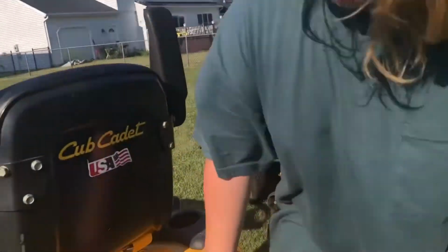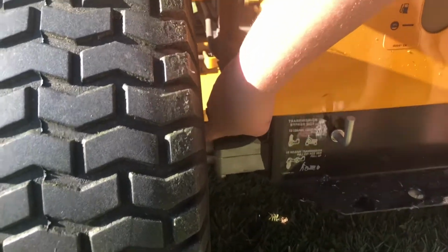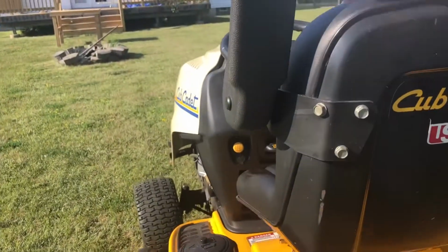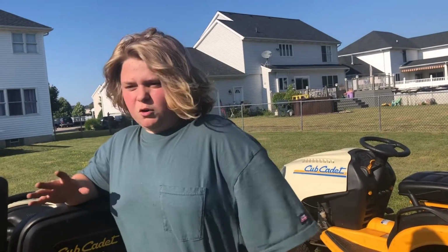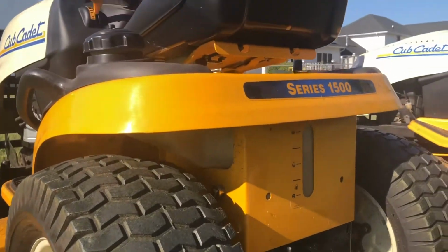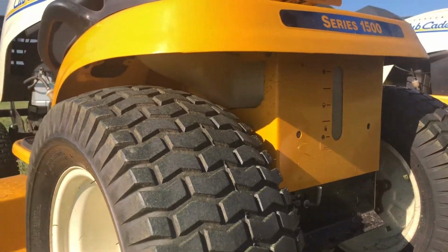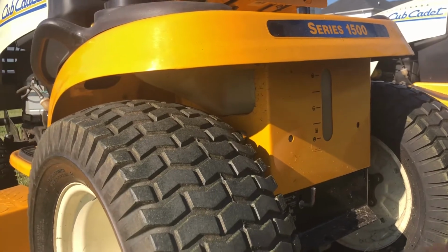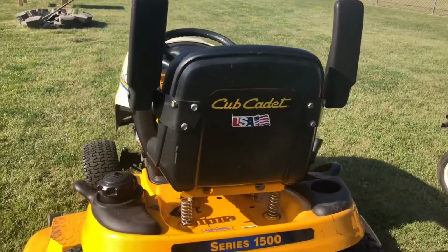Generally, if this has a G730, the torque will be 230 foot-pounds. If it had what they call a 300 series by Hydro Gear, which is older, obviously, since this is an older machine, it has somewhere around 350, so it's going to have a lot more torque depending on the model. You can tell if this one has an oil filter, which it does not. So this means that this is in fact the 300 series hydro that came in these. So this is the heavier duty hydro.